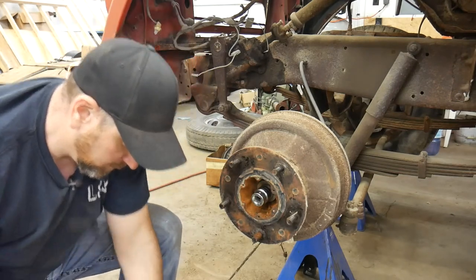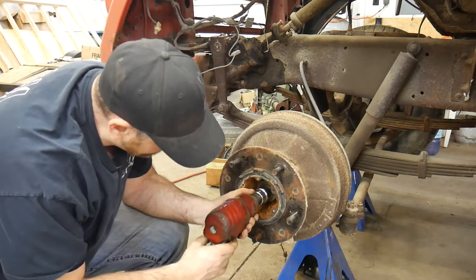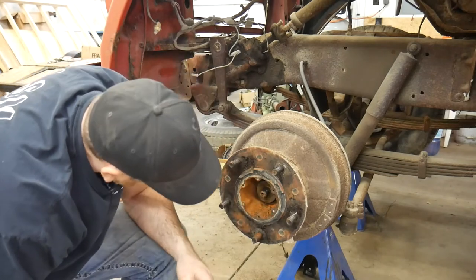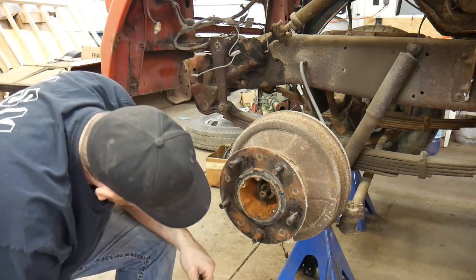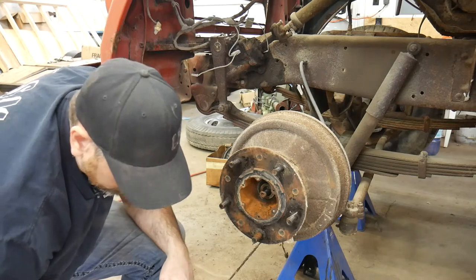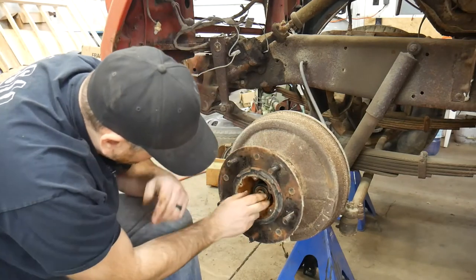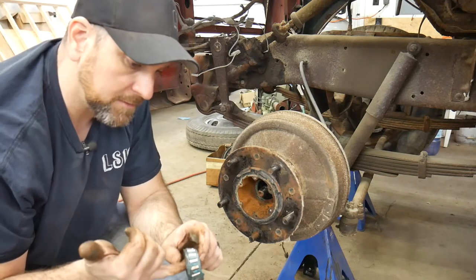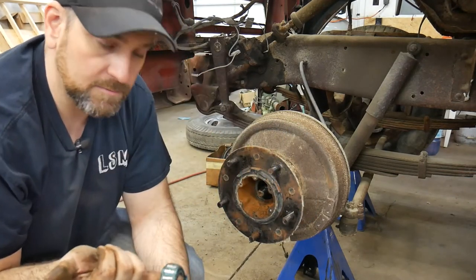So these are three-quarter drive sockets and I had a half-inch to three-quarter drive adapter. There's no need to clean those threads off because the nut coming off just cleans them for you. It's just going to be filled with grease — something that's all going to come out at me and be gross. This all looks fairly new. This crud getting in that bearing makes me nervous, but the bearing actually looks fairly good — I might be able to clean that up and use it.